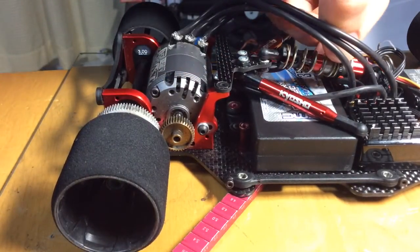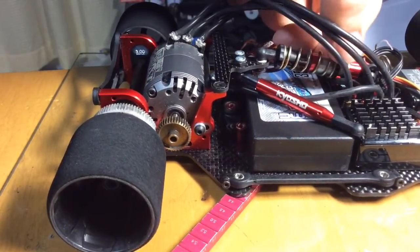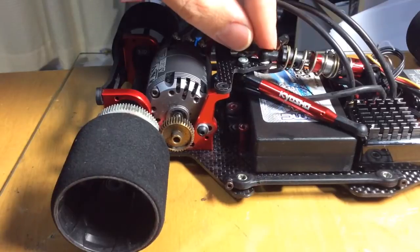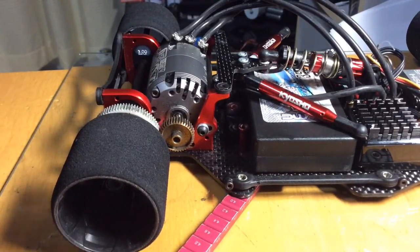And how to bring it down? You want to take the shock collar and thread it down. All right, thread it down a little bit. Let's measure. Perfect. I was lucky. So now the pod is resting at its original height, 3.8 millimeters. I adjusted the spring tension to bring down the pod.